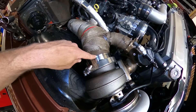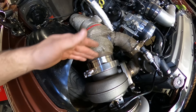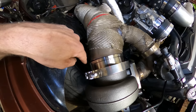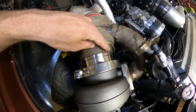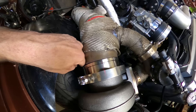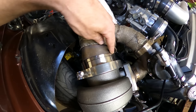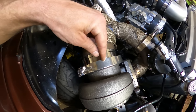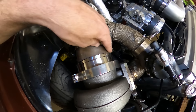Okay, we got the exhaust flange finally. I had cut the downpipe off — or the old flange for the downpipe off — and got it made pretty decent. I do got a gap on the bottom which kind of sucks; I was really hoping to get a perfect cut but shanked it. So I'll just have to weld up the gap or get a filler piece. It's not that big of a deal. I'm going to weld as much as I can while it's on the car with the V-band clamp on. You don't want to get it too hot to where it warps the V-band and doesn't make a good seal, so we're going to weld that guy up.